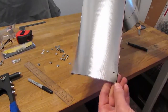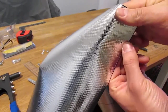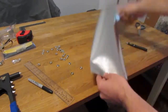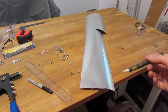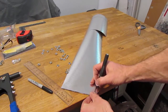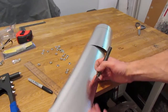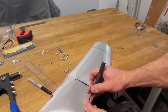What you're going to do is mark off the locations on your heat shield — I've just used little dots where you're going to want to put your button snaps. Then you're going to take either a hole punch if it's the appropriate size, an exacto knife, a sharp screwdriver, or something similar, and poke your holes to allow your fasteners to pass through the material.